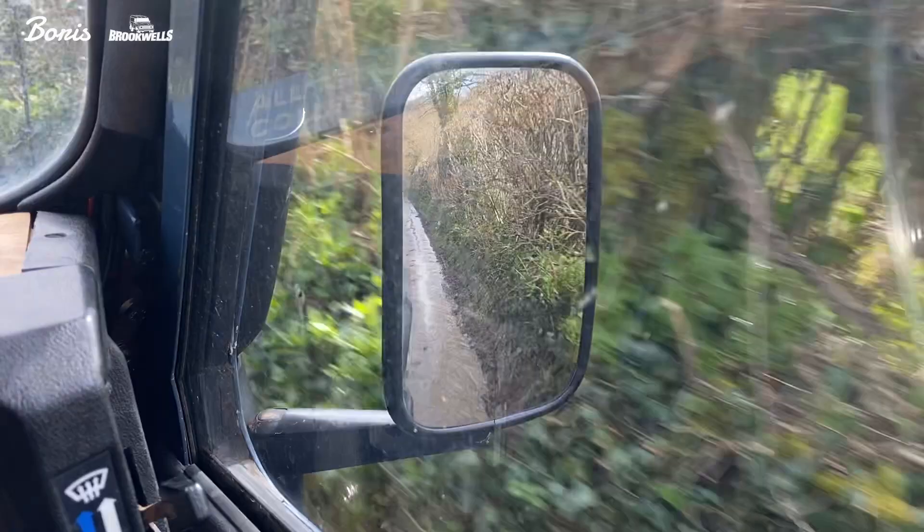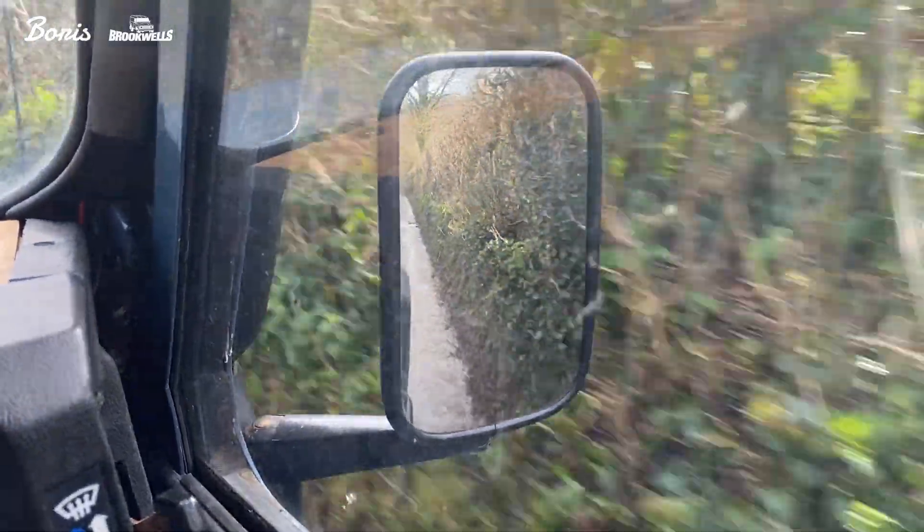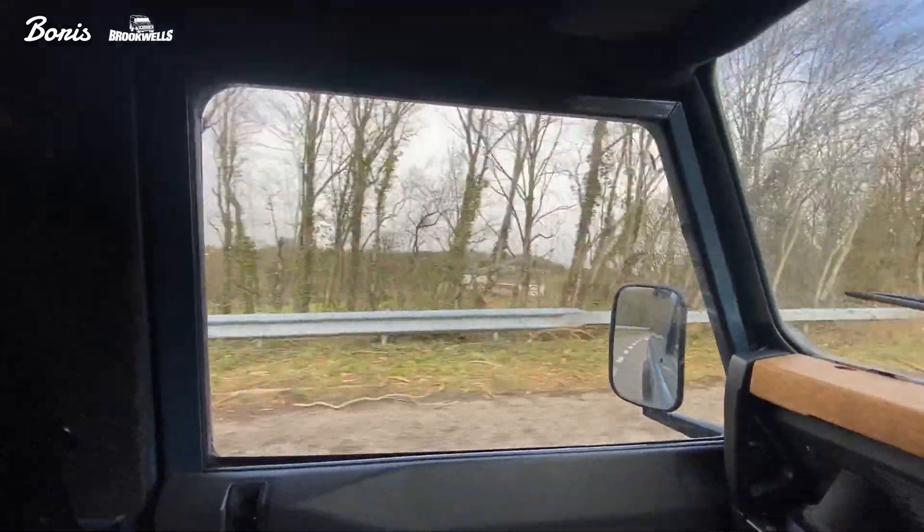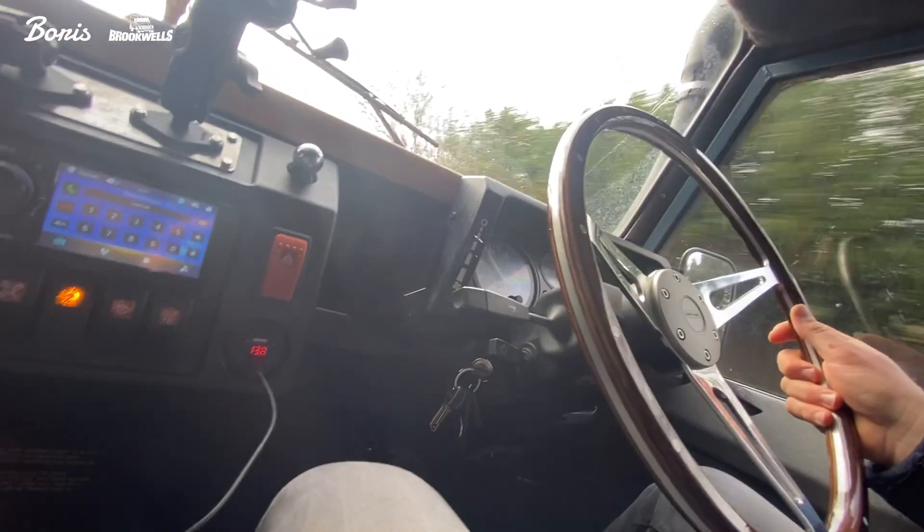This one's done 200,000 with no history, and the piston rings are worn, so it's really down on compression. You can feel there's no power. I'll try and go up a hill and it'll just bottom out so quickly. I'll try and bog it down now — black smoke comes out the back and it bogs down. There's nothing to bring it up out of the lower revs, so that's a bit of a shame.